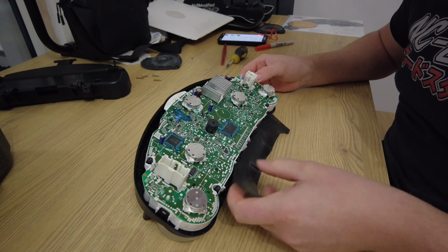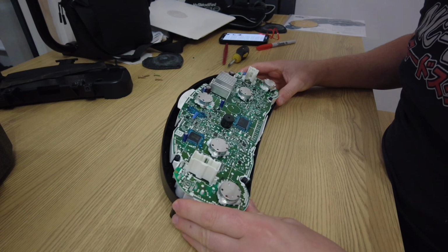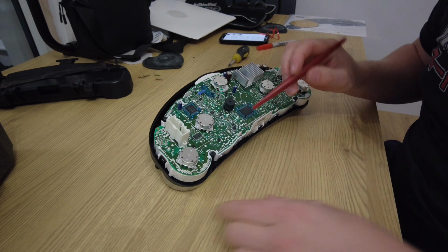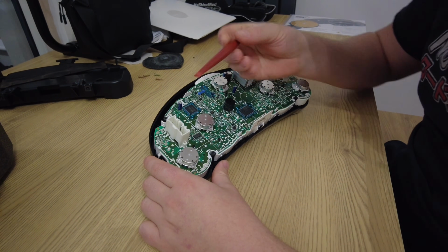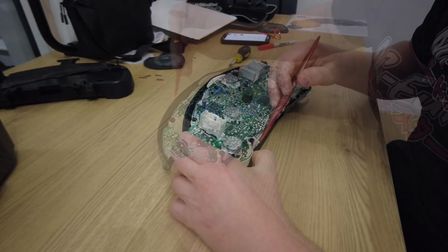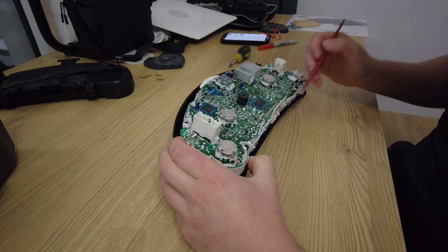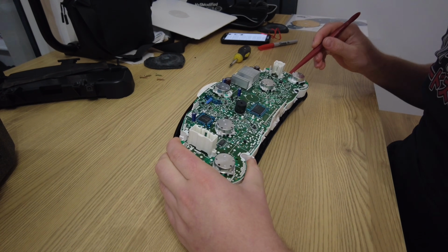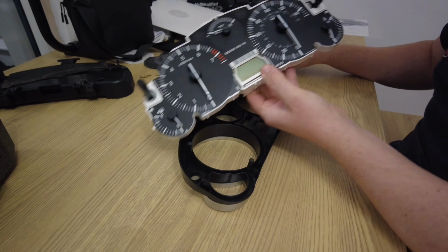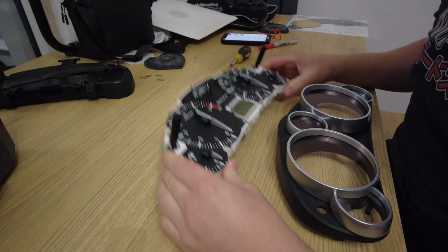So you need to remove this flap first. Install that safely. And then you'll see that around there are these clips where it clips on. Use anything, a flathead screwdriver. I'm using this little piece I've got for removing the interior panels, I think, or it might be for wrapping, and you literally just need to pop it all off. There we go. So what I'm next going to do is set this to the side.